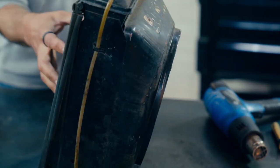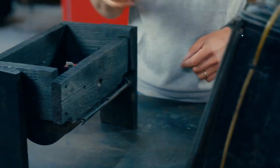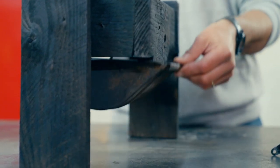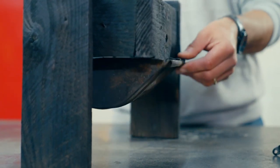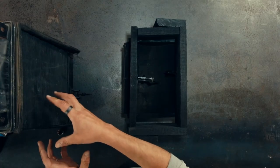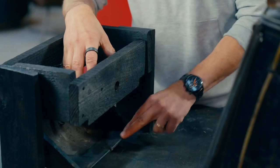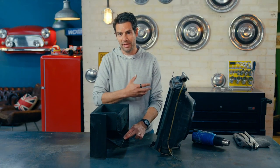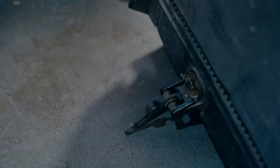What that does is force cooling air through the radiator, drawing away the temperature, but then that hot air has to find a way to escape the car. It does that through this cooling flap. Now if the flap's open because the system's working properly, that hot air can escape. If the engine's not up to temperature, the flap is closed and the heat builds up behind the rad, bringing the engine up to its operating temperature.